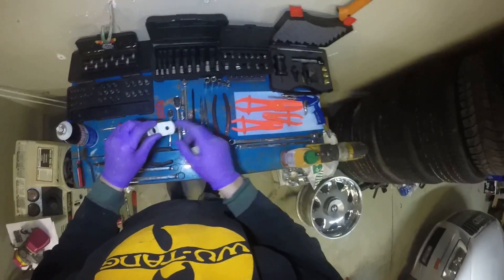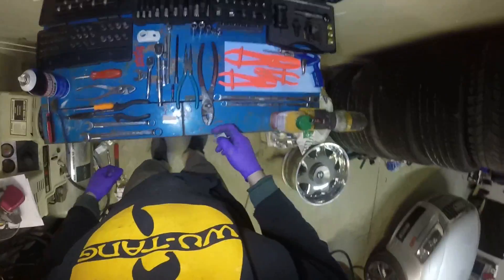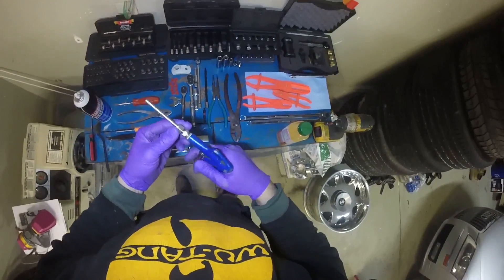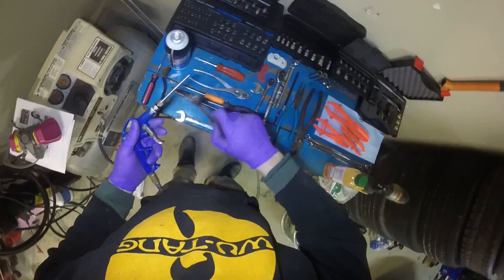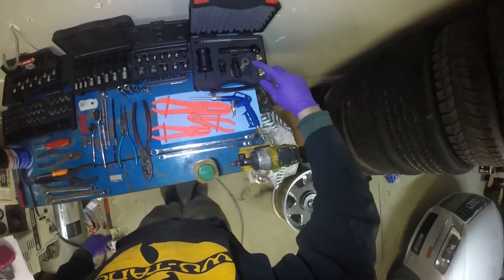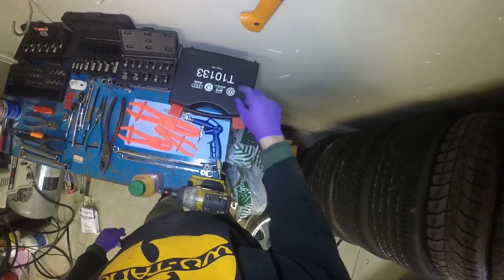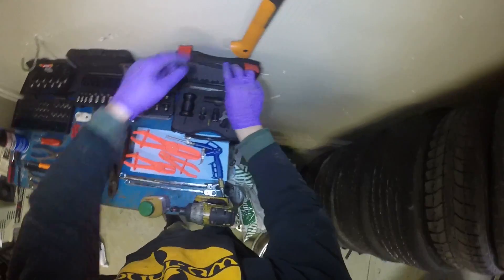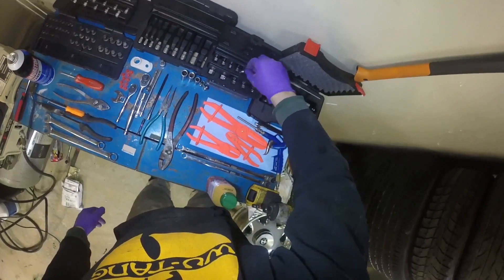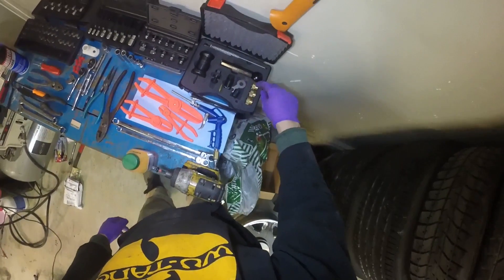These are really awesome — put them on the end of a flexible GearWrench drive and you can get into some really tight areas. We also have our FSI walnut shell adapter with vacuum port and media port, made by a guy called Ford Prefect on AudiZine. Before we get started, get your hydration station going. Here's my little gun that I made up — it's got a little compression fitting. This is the kit you need for injector resealing; this is an OEM kit T10133.